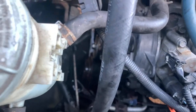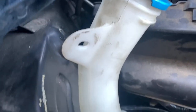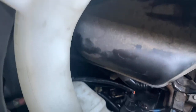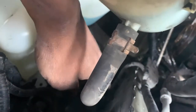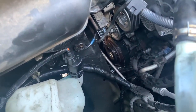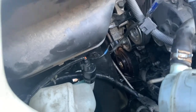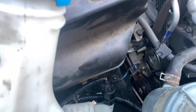Alright ladies and gentlemen, in order to get this alternator out — and it was not fun, I do mean it was not fun — you're going to have to disconnect this windshield wiper reservoir. There's a 10mm bolt that goes over here and another one at the bottom. If you turn the alternator sideways, you can get it up through here, push it past the reservoir to the side and get it through that hole. But it was a bitch.